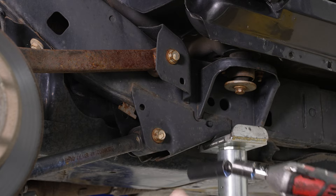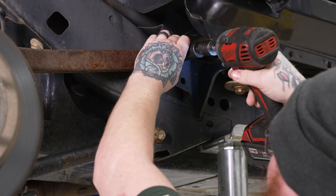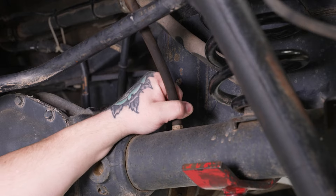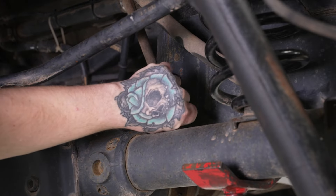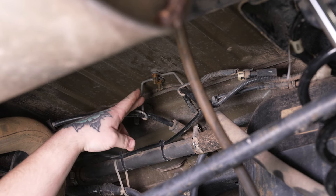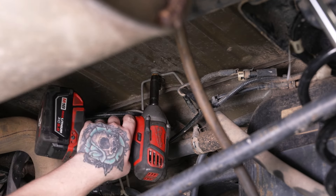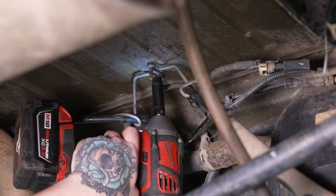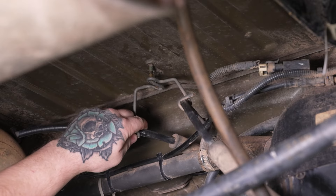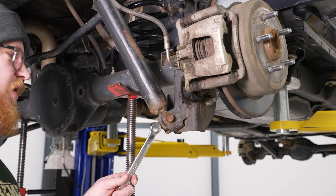These do have flag nuts on the back side, so you don't need a wrench for that. Next we're going to come under here and pop our vent tube off of our differential — this will prevent it from getting damaged while we lower the differential. It simply just pops off with no clip. Now we're going to remove the 10mm mounting nuts holding our parking brake cable bracket in place, and go ahead and make sure our bracket comes down freely. After that, we can remove our lower shock mounting bolts using our 18mm socket on our impact and an 18mm wrench.